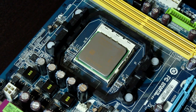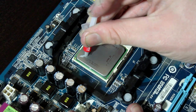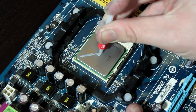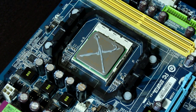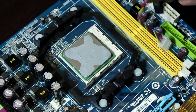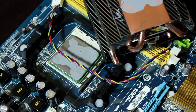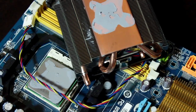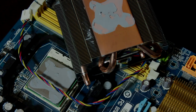Last but not least, we're going to do the X method. It's just like the line method, only you make an X across the top of the heat sink. The idea of the X is that it's supposed to help the paste get into the edges and corners a little bit more. As you can see, we've got better coverage on the heat spreader. I'm going to chalk the remaining gaps up to the low-quality Thermaltake thermal paste — I don't recommend that stuff at all. But I definitely do recommend the X method because it does get better coverage.